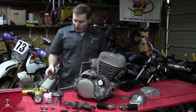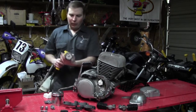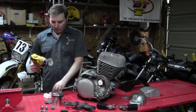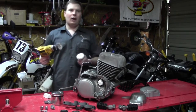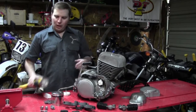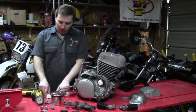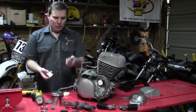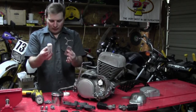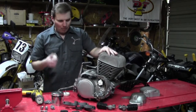Getting down to actual polishing, there's a couple of things you can do. I'm going to use a cotton buffing wheel — there are different ones you can get that go on different types of tools. You can buy these kits at most tool stores, auto parts stores, or online. For the home shop, these are going to work just fine. There's also what's called buff bobs — maybe cone shape or ball shape — for getting into different areas. You also need some different compounds: there's Jeweler's Rouge, generally for gold and silver and a finer finish. This one here is for more of a heavier cut. There are even heavier cuts than these, depending on how much corrosion you have. This aluminum is in pretty good shape — just a little bit of scale — so this will probably be good enough.